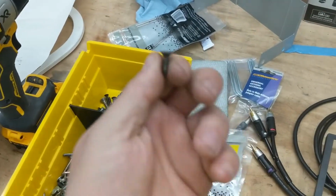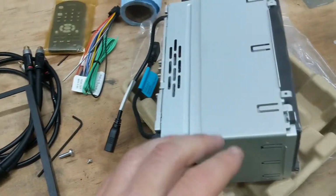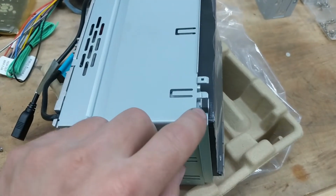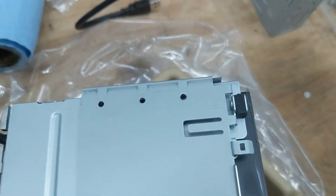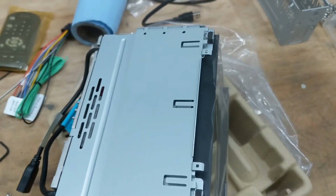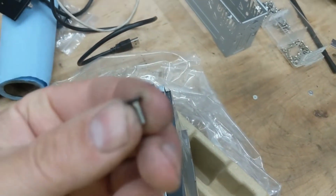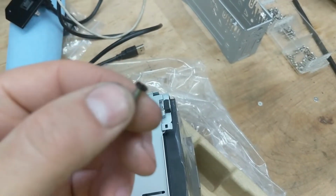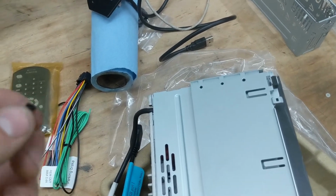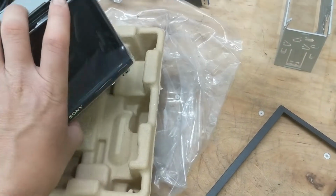I have kind of a screw bin, and I found two that worked, and I took them to the bench grinder and shortened them. So to get that extra compensation, I needed it to stick out some more, so I added a little spacer right in between where everything mounts. So this will space it out the perfect amount. And then I needed some longer screws because they have to be longer, obviously. And I had these little stainless ones, and I had to take the head to the bench grinder to take off some material, otherwise this plastic snap wouldn't fit.